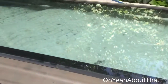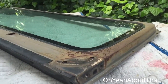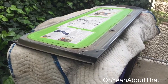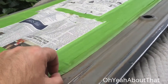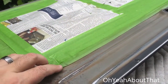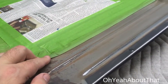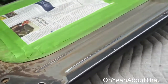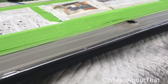I'm going to take this off, sand it down, clean it up, and put some primer on it. I've got the windshield frame all sanded down and it's actually primed on the other side. I was going to peel these black rubber moldings up and rope them — stick a piece of rope under there so they sit away from the surface so I can get paint under there — but unfortunately they're just way too brittle. I didn't want to have to install a windshield, or else I would have just bought a new aftermarket frame, so I just taped up to it.